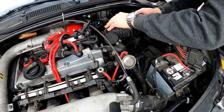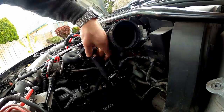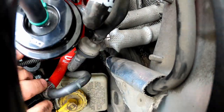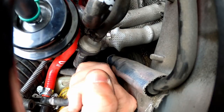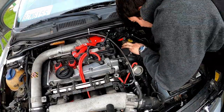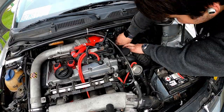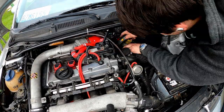Thankfully, this is a lot easier to do than it initially sounds. You take off the intake and slowly start removing each one of the connections to the OEM turbo inlet pipe. You might be worried about accidentally removing a coolant line, but so long as you make sure that they're connected to the turbo inlet pipe, you'll be fine — the only thing that should be in there is air. It also doesn't matter which order you remove these in. I personally removed the PCV, then the diverter valve, then the N75, and finally the brake booster — this was just the order that seemed easiest for me.